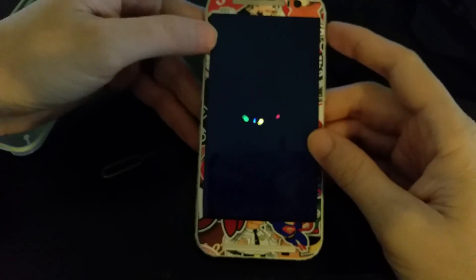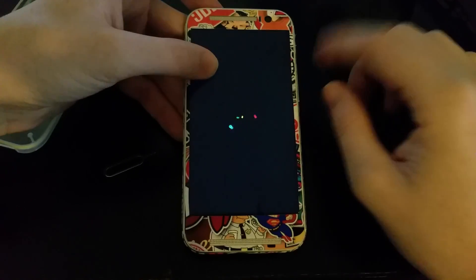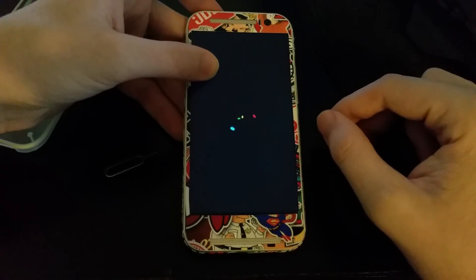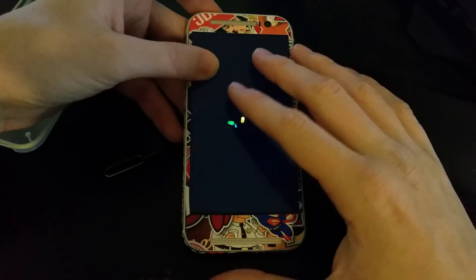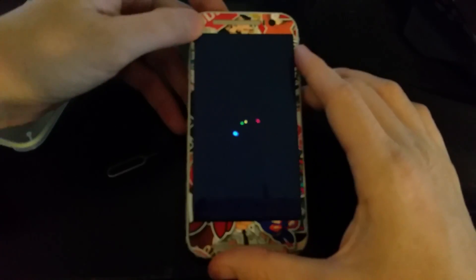All of our apps are backed up to the micro SD card, which is behind this little door — it looks like a SIM card slot but it's not. Once you back up your apps to internal storage, open ES File Explorer, move them to external. Go to Titanium Backup, set the backup folder location to the external SD card — from then on it reads and writes from external. If something like this fully wipes your phone, you still have all your stuff on the SD card.